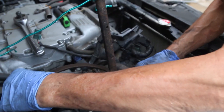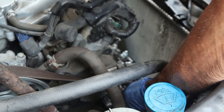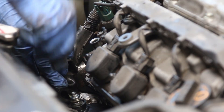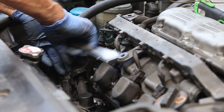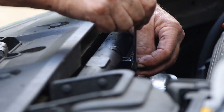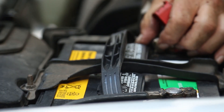If your car is not charging the battery, it's potentially the alternator. Normally these Honda Accords don't fail very much, but this one has over 10 years on it so it lasted a long time. Then all you have to do is connect the electrical connections and you should be good to go. This is a very difficult procedure because it's just tight, but it's very easy to do if you take your time. For the fan, tighten from the bottom — there are two bolts that pinch the fan together. Make sure you connect the fan connector before you put the fan in, then bolt the bolts on top and put the battery back on.